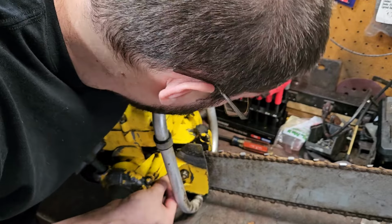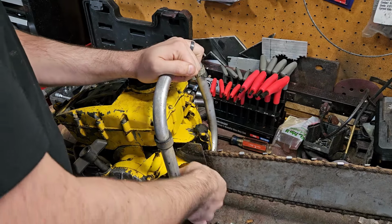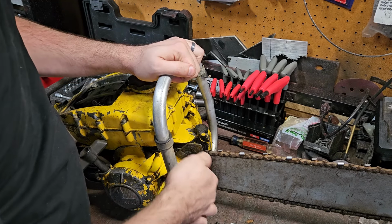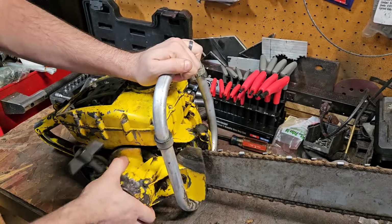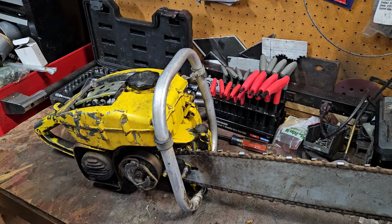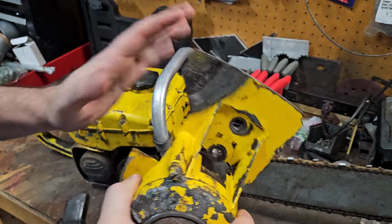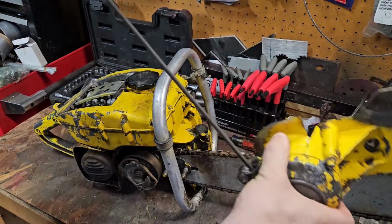We'll spray her down with some WD-40 and start cleaning the stuff off of it, and then we'll get some other stuff on her. Maybe hit her with a wire brush, put her on the sharpener. But we gotta see if she's gonna run first. Put the nuts to the side. No tensioner. Foot stepped right on it. There's no tensioner built into these right here. That's later on they designed it to where it was right here. Made it so much easier. Starter feels immaculate. It feels real good.